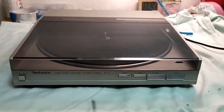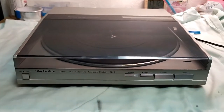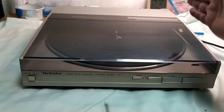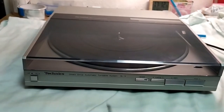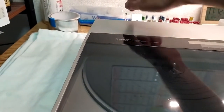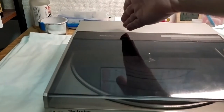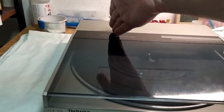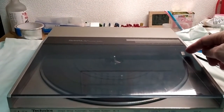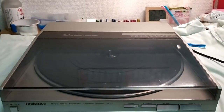It's nearly time to wrap up this project. All that's left is to stick it in the lounge room, play some records, and see how it goes — just ensure that it's starting in the right position and playing all the way through. There is an adjustment screw right there; you can move it a little bit and that adjusts your start position. It mechanically moves the stopper so it stops where it should. I think it's actually okay because when it starts it advances just a slight bit and then drops.